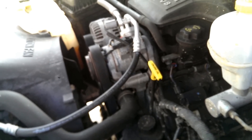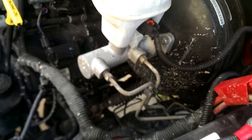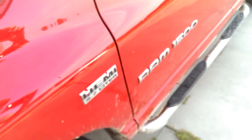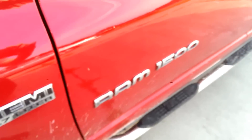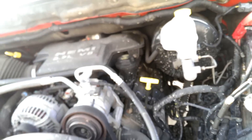The problem I was having with my starter was it was just old. It wasn't starting well — the first few cranks seemed to take out a lot of power from my truck. I went to AutoZone and they tested it, and they said my starter was pulling too much power. Then a few weeks later my truck just wouldn't start. I smelled the solenoid, so I knew my starter had burnt out and I needed to get a new one.